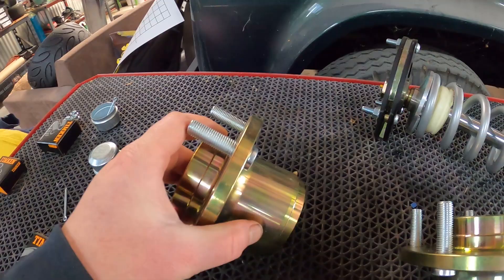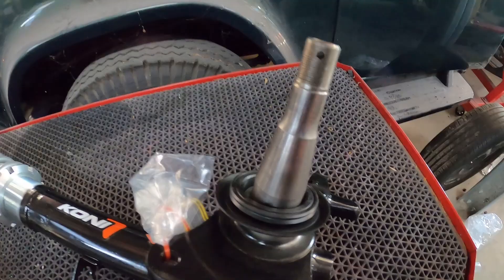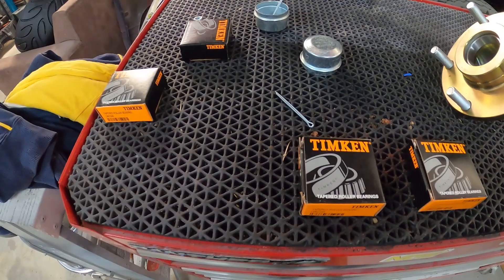The kit includes two front adapters and two seals — the seal goes onto the base of your stub axle, then you put your two wheel bearings in, hub adapter goes on, and then tie it off with your crown nut and split pin. You actually get your Timken bearings in the kit — they come in different sizes, big one at the back, small one at the front. Grease them all up and put them in. And then to tie it all off, you've got your little end caps and your split pin to go through your crown nut.